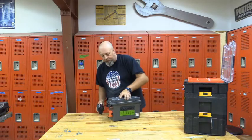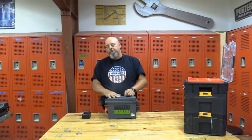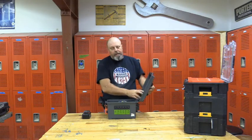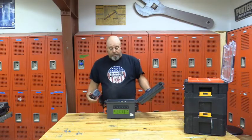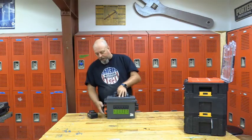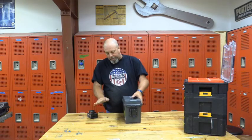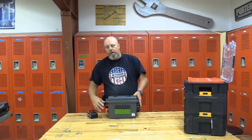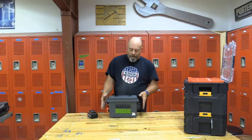That wraps up this video on how to make your own trailer test box. You can make it out of whatever box you want — just make sure you have enough room for your plug. You can do it in the lid, but I didn't want wires coming up. By the sheer amount of wires in here, it's not bad. I'm glad I didn't use the smaller of the two plastic ammo boxes — trying to get a battery in there would have been more of a challenge. The switches are not protruding anymore, so I could stack two of these together if I wanted. The only protrusions on the side are the jumper posts, the battery connector, and the plug — only about a quarter to a half inch on each side.